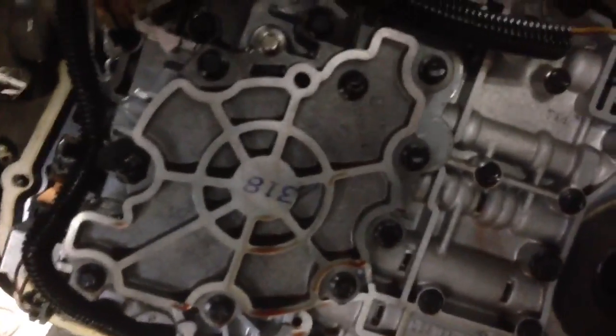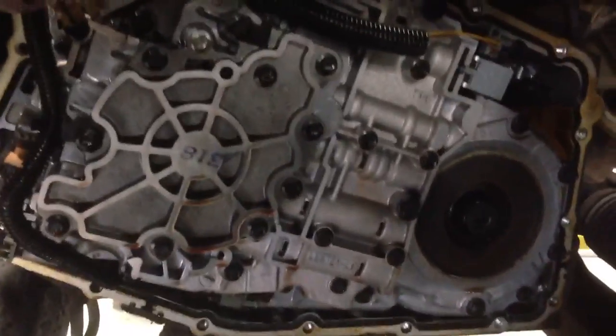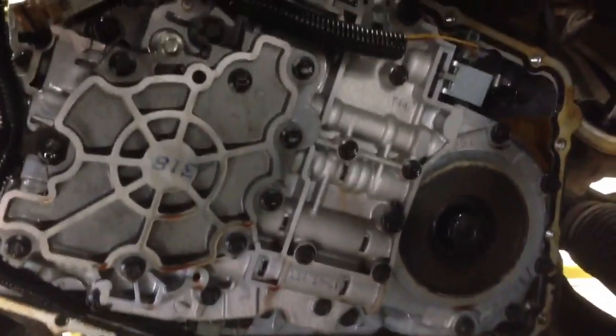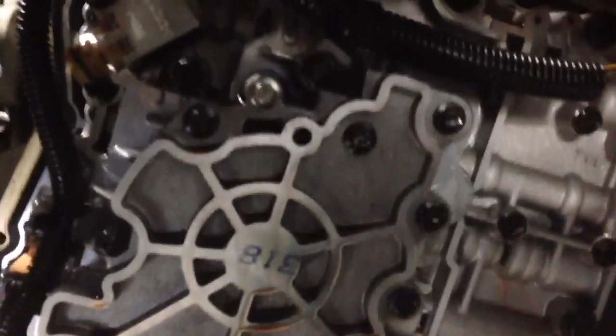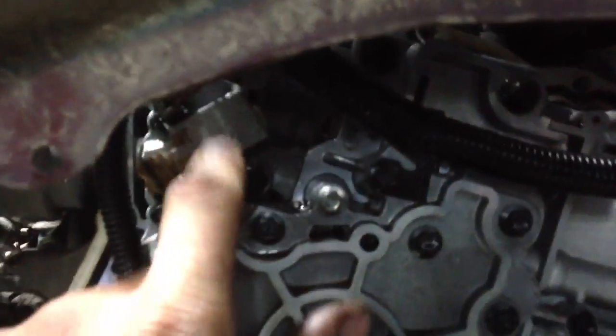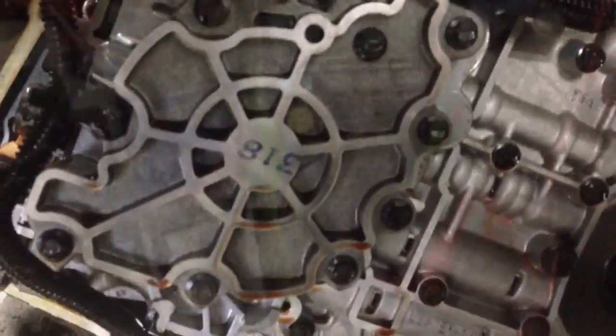And that's a fix. We'll have first gear back, check engine light will go away, and this tranny will be good to go. So just a little video for you guys — it's easy to diagnose. Hope this helps anyone looking for solutions to this problem. Most likely it is your solenoids — these go out really frequently. But I have seen faulty PCMs cause the same problem, and I've also seen shorts to the transmission case and wiring cause that problem too. But the solenoids are the most likely cause — they're cheap, only about 17 bucks, and they're not too difficult to get to.